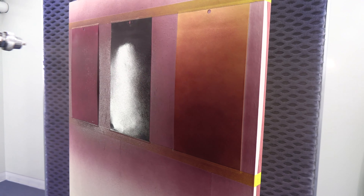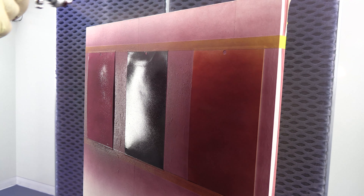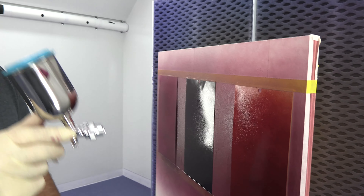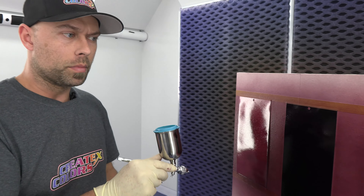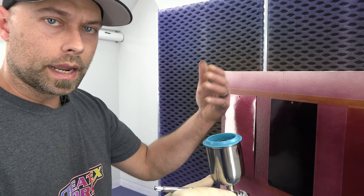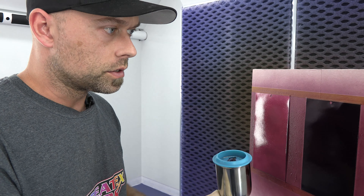20% to the overall mix — I got it mixed up. We're going to show you what it looks like over silver — that's our Wicked Silver — and over Autoborn Black and our Wicked Gold. So those are the base coats. I'm going to use my Iwata TH2 for this one. I love this little gun; the fan pattern on it is great for spraying candy.